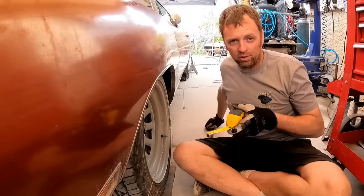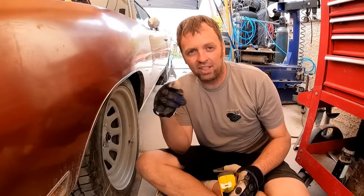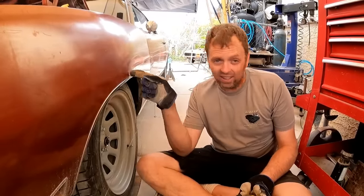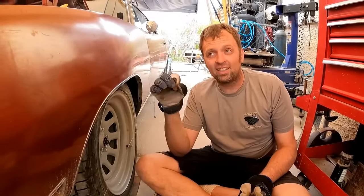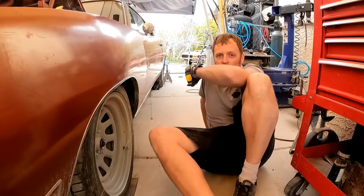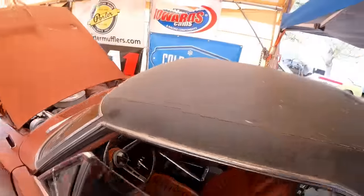And a tad under. I mean, we're talking like between one side of the line and the other on 7/8, which I'm going to call a 32nd. So a 32nd in, that is a 1/16 of an inch total. We're going to lock down the tie rods right there. Let's double check, make sure the steering wheel is still straight. Yep, the steering wheel is still straight.